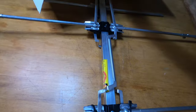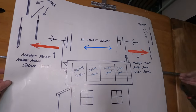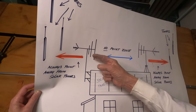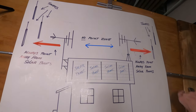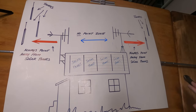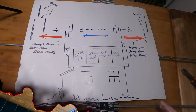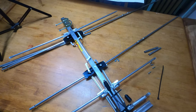Another thing I want to point out: don't ever point your antenna across the solar panels. If your towers are here, you want to be on this end of the house — you never want to shoot across your solar panels because we've found that it can affect one, ten, or all of your channels. Thanks for watching. Please subscribe and hit that like button if you would.